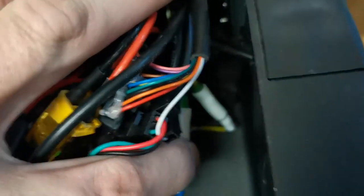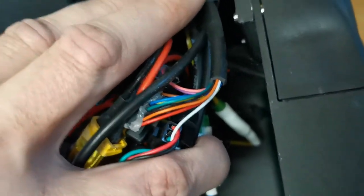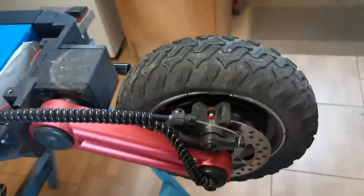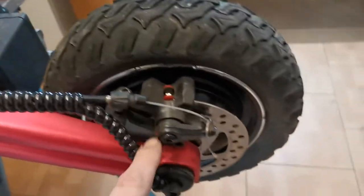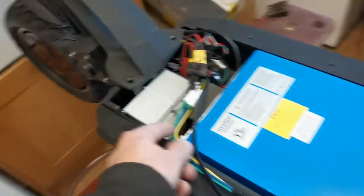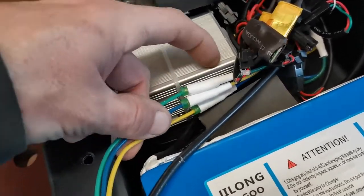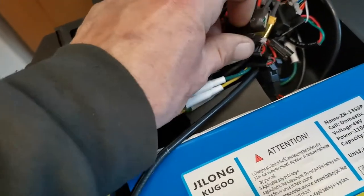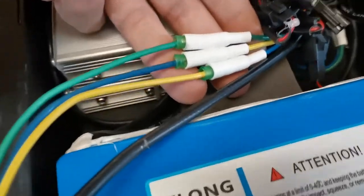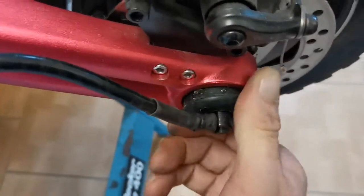For the front motor, blue goes to blue and yellow goes to yellow. We need to liberate this cable of all the spiral binding so we can thread the actual cable to get the nut off. That means disconnecting these three wires here — remember whatever configuration it was in — normally green to green, blue to yellow, and yellow to blue for the rear wheel.